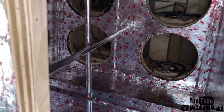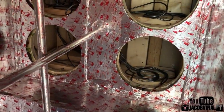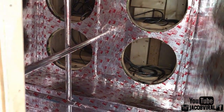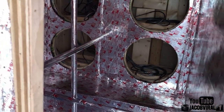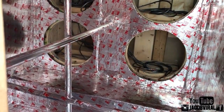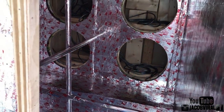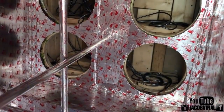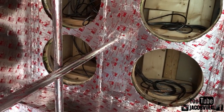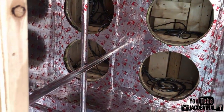And that's how I decided to test it to start off with, as big a ported enclosure as possible. So right now I have 41.1 cubes in the ported enclosure side, and that's all the way net after the bracing displacement, all the way out to the port, 41 cubes. And the sealed is 7.2. So 7.2 and 41, that's around a 5.8 to 1, so almost a 6 to 1 ratio. Fourth order is my goal.